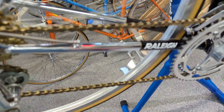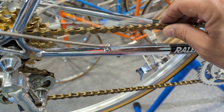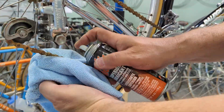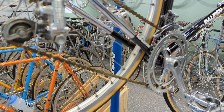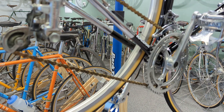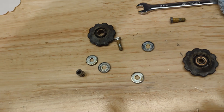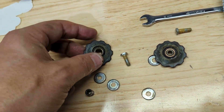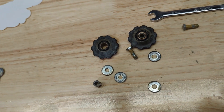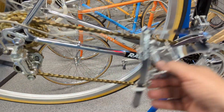I thought about leaving this off camera, but when I turn the pedals it almost seems like the bottom bracket is too tight — it feels stiff. I think it's the new old stock chain; I think it's a little gummy. I'm going to throw some lubricant on that and see what happens. Okay guys, show of hands in the comments: how many of you are yelling at me saying 'it's the pulleys, you idiot, causing the drag'? Actually, you would be half right — I pulled the pulleys off and sure enough there's some drag in the pulley, so I cleaned them up and put them back on. Much better — it was the pulleys and the chain; I think it was mostly the chain though.